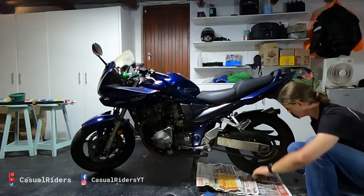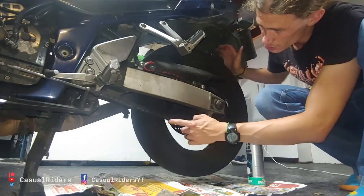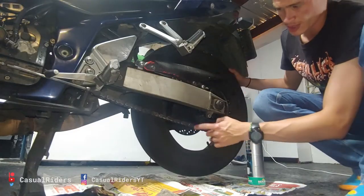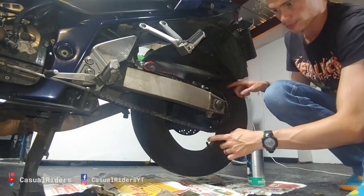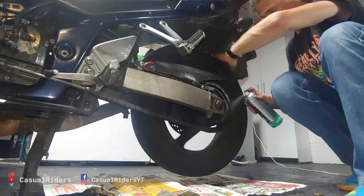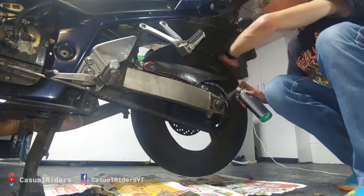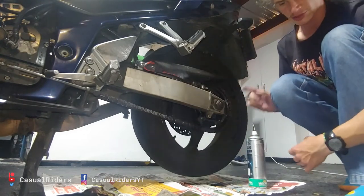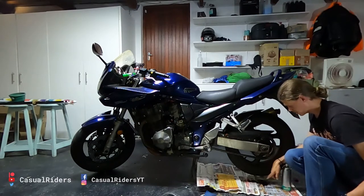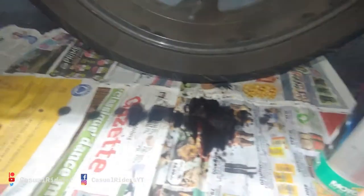We take our chain cleaner and apply it onto the chain while rotating the wheel. Normally an easy way to do this is to find your master link — the one with the two darts. Start with the master link up here so that when you apply, you know you've covered everything from start to finish. I'll line up the master link and start spraying. I'll do one complete rotation of the chain to get all that cleaner in nicely, and you can see just how much stuff is dripping down here.